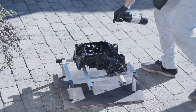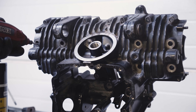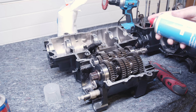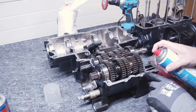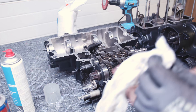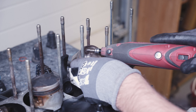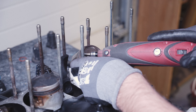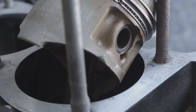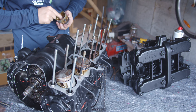It's the same procedure on the bottom half of the crankcase — a lot of more or less boring work getting into the nooks and cracks. Here's a tip: if you're going to clean the mating surfaces, this spray actually removed my spray paint, so do that before you paint the crankcase surface. I'm also removing as much buildup as I can from the pistons. While working on this I noticed that one of the pistons had a little scuff or mark where the metal was actually coming out, so I had to take that piston off and grind that away.